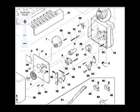Before you start to condemn the ice maker and begin diagnosis and repair on it, make sure that water is freezing in your freezer. Put a cup of water in it, or an old ice tray if you remember what those were. Make sure the freezer is working properly before you continue.